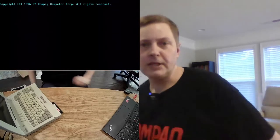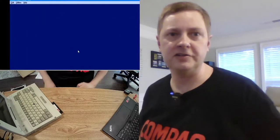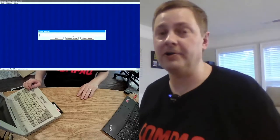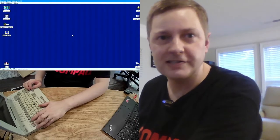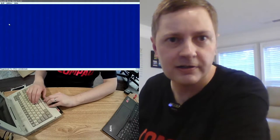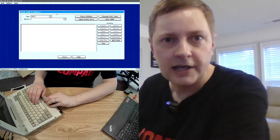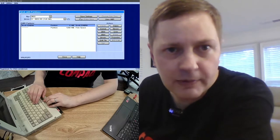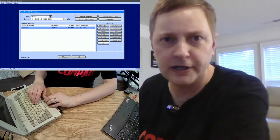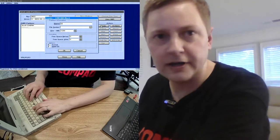All right, so see that starting up? Oh, it's a little bit off, that's okay. This thing tends to be a couple of pixels off. All right, so I don't have any partitions on here at all. So that's the first thing we get to do is make some partitions. I'm gonna come into here to partition work and create an MS-DOS partition. Yeah, okay, so we've got a booted partition on there, but I don't have any MS-DOS, so we'll make like a 500 megabyte partition, just call it DOS.